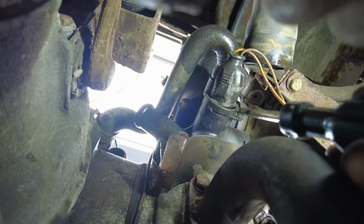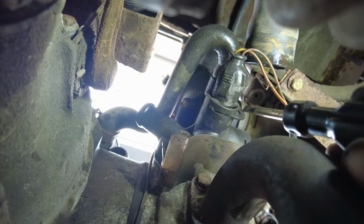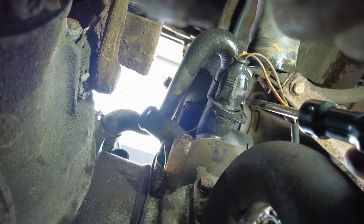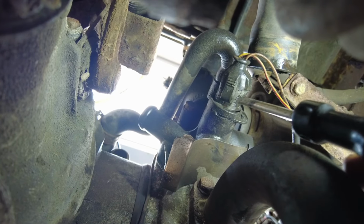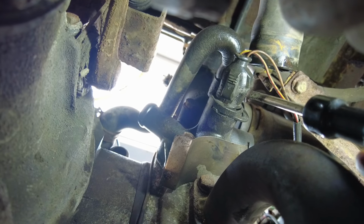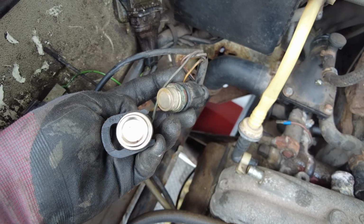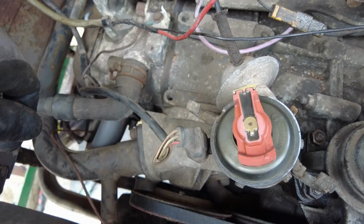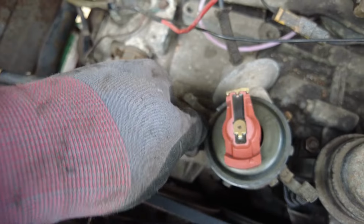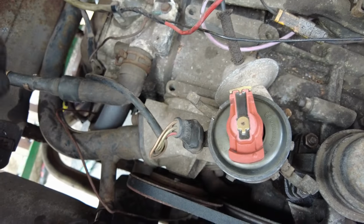And underneath at the back is another sensor, a little sliding clip that comes out here, look. I can't do it with one hand, so I'll have to put the camera down, and I shall mark that one as B for back or bottom, again so I don't get them mixed up later. Like so, I just stick them to one side out of the way. So that just leaves the plug on the side of the Dizzy here, which we should be able to get off relatively easily, all being well. Maybe not with one hand.